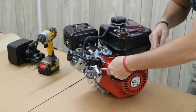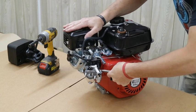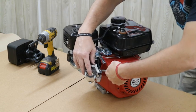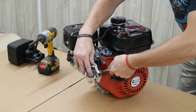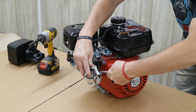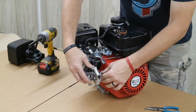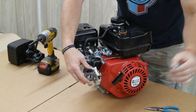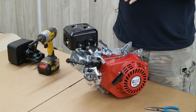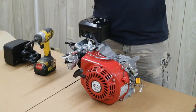Slide the clamp down, start to pick up on the fuel line, then go back and slide the clamp some more. The reason we're sliding the clamp down instead of up is because there's a large barb on this fuel inlet which keeps the clamp from sliding over the barb. Now we've got that unhooked, we can take the clamp off and remove our tank — fuel line and all. You won't need this anymore, so we'll just disregard the tank.